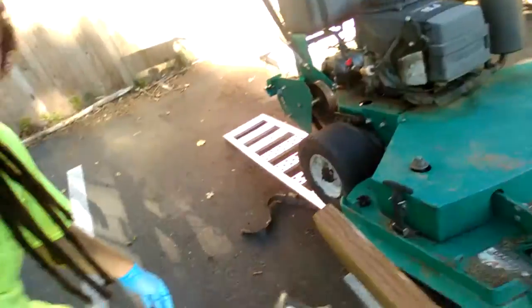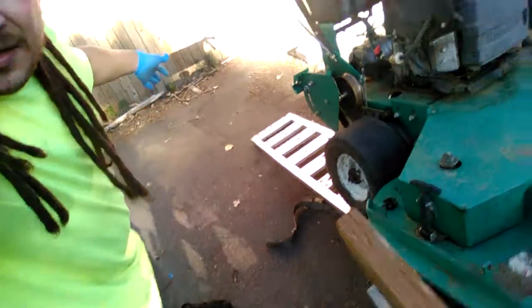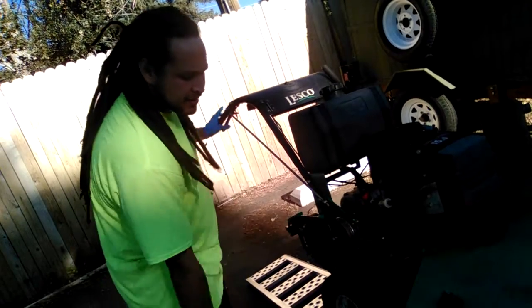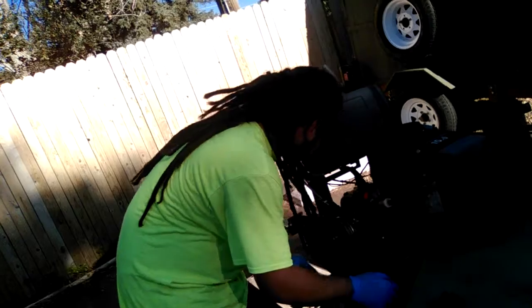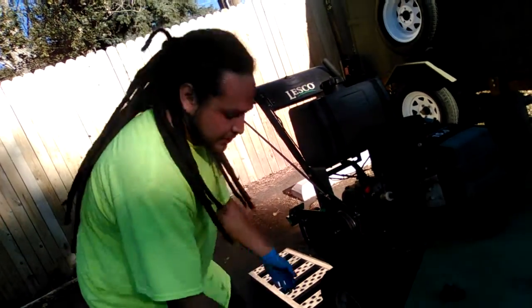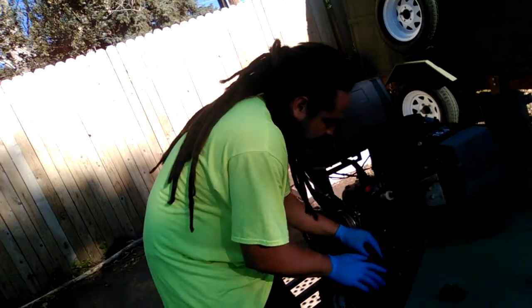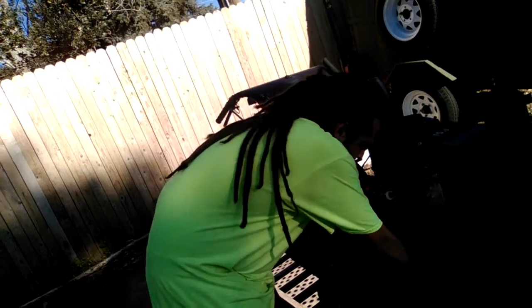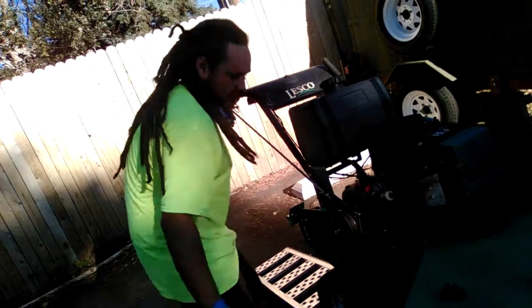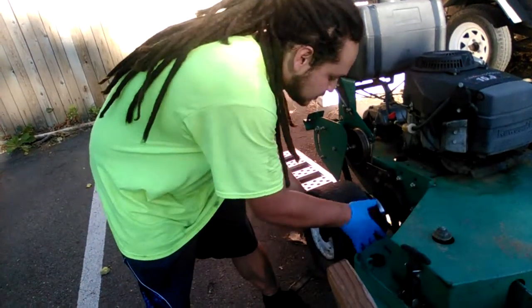Put the brick underneath — now there's a gap so this is actually free. I put on this so it loosens up the belt on the tire, then get the belt off the tire. Make sure it's loosened. Sometimes you've got to push the handle. After you have the tire off by squeezing the handle and loosening the belt, it should just come straight off.